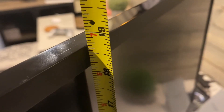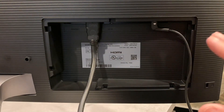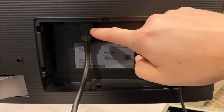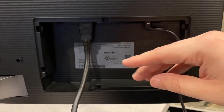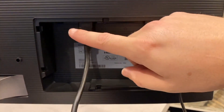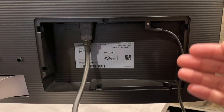Got it on my desk. One measurement I forgot to mention is the actual height — from desk to the top is about 18 and three-quarter inches, with about 16 inches below being the actual screen height. I've got my HDMI hooked up and the power cable connected. One important thing to mention that a lot of people don't bring up: you want to make sure you're hooking it up into HDMI 2. That's the only way to get the full 4K ultra high definition content on this QLED display. For some reason HDMI 1 does not give it that 4K capability — it has to be HDMI 2.